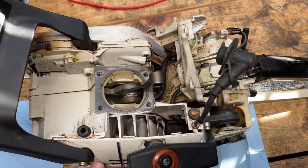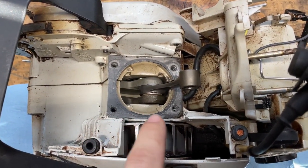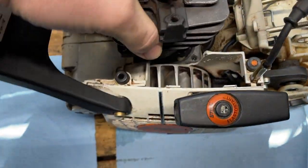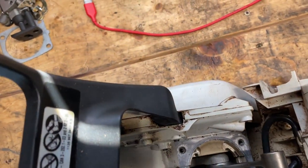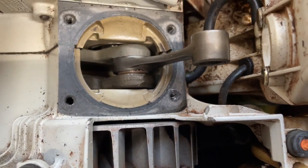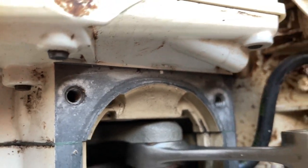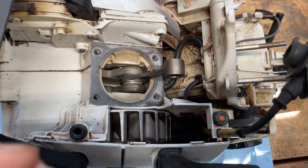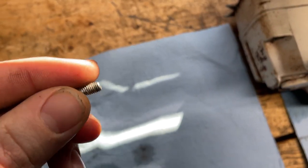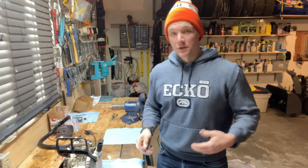I actually had this saw almost all back together — I have a full length video of the repair on this saw. But when I was tightening things back up, I noticed that these two bolt holes on the engine case — the cylinder sits in here and then you tighten these two bolts up — they were spinning free, so they're stripped. As you can see right down in there, that does not look pretty, and neither does that. These two look good; you can see the threads in there, they're intact. And here's the real telltale: this bolt, right there at the end, has the remaining threads from inside one of those two engine case bolt holes.